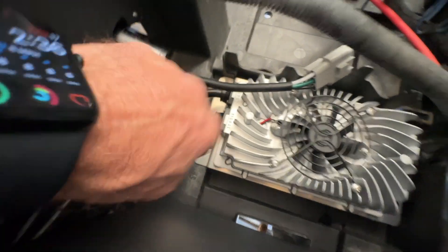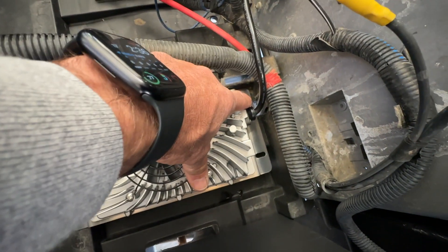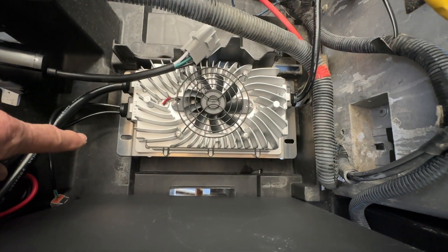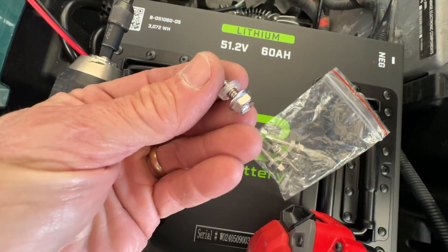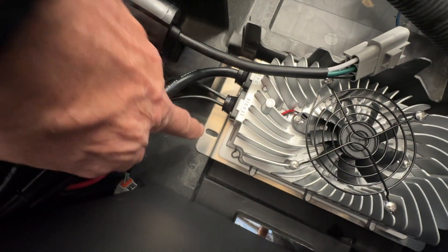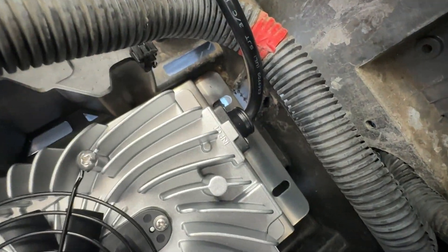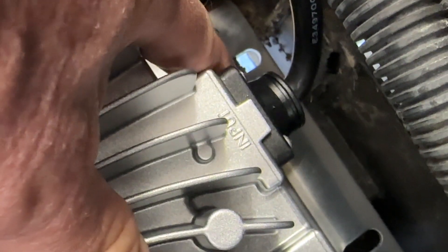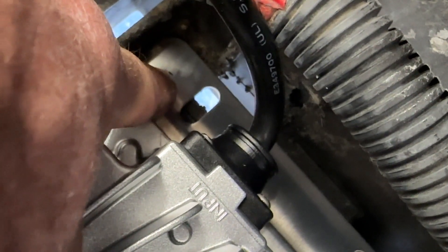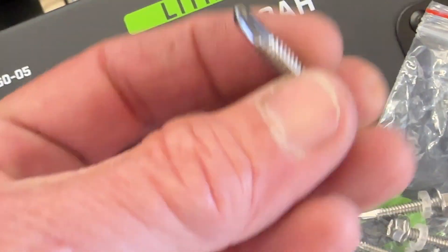It's right up against this little notch — it's got a little bit of slop, not much, maybe a sixteenth of an inch — but when I cut that slot it allowed it to be shifted, so it is as solid as it can be. On this Club Car Precedent there's nothing underneath here, so I'm going to take these supplied self-tapping screws with a driver on my drill and use these two holes here on the front. For the rear hole, I'm going to scoot over just a bit and mount it right through the metal — the aluminum. These self-tapping screws cut into the metal pretty easily.